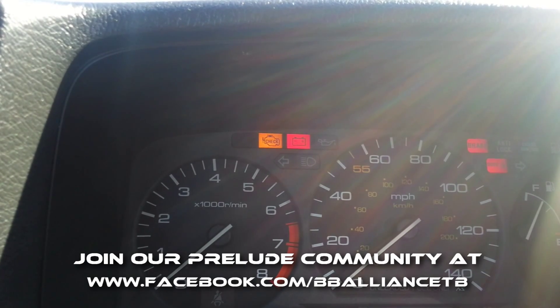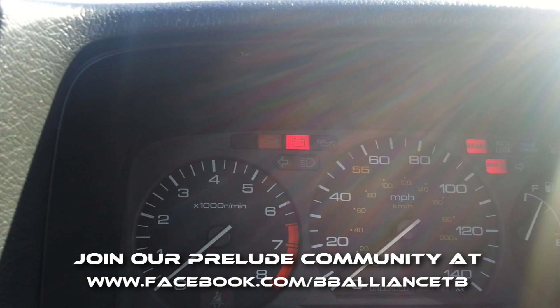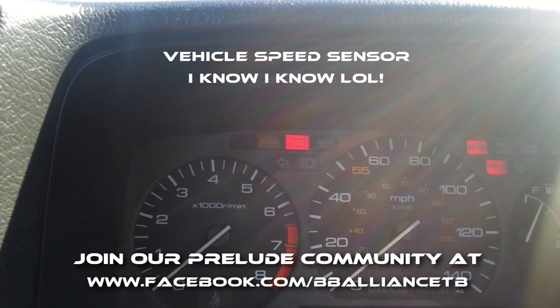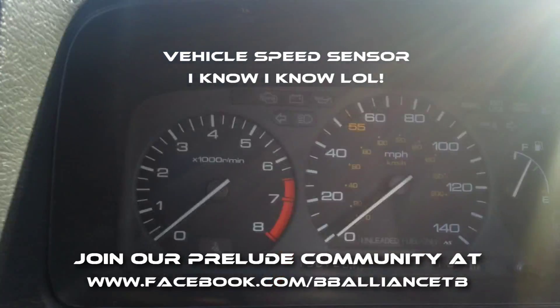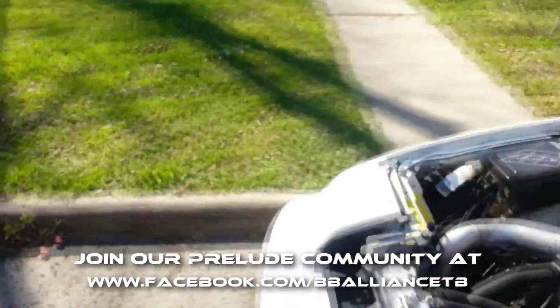In this case I have a long blink — that's ten — followed by seven blinks, so I have a seventeen. Code seventeen is the VSS, which is the Vehicle Speed Sensor. That's what's wrong on my car, so now all I gotta do is replace that and we're set to go.